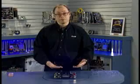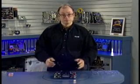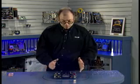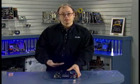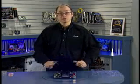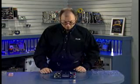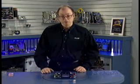That's actually normal. In fact, you have to ensure that there's enough clearance below the board to make sure that there's going to be no short circuits. That is, the board's not going to actually touch the bottom of the chassis. So that's normal. In fact, they caution against using any stiffening devices on the bottom of the board because that'll prevent this from happening and overstress the board and probably crack it. So in other words, this bending of the board is actually intentional and a good idea in this case. It does show how much force is being applied by this heatsink to the processor.